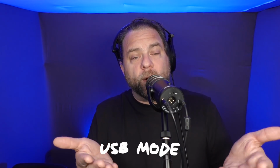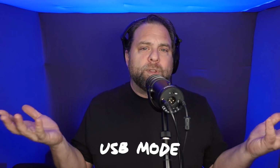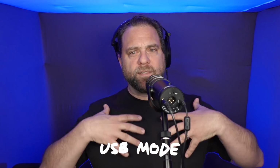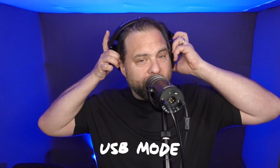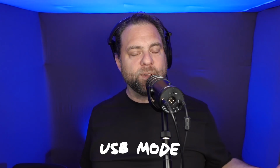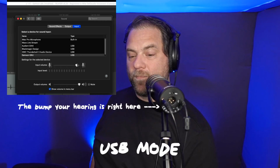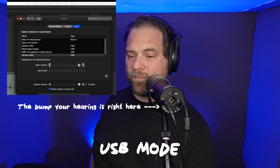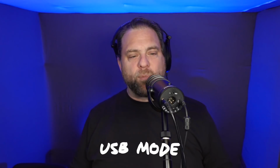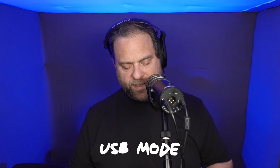Okay, so this is the USB mode, and hopefully that helps. Should sound like a microphone. The quality, I sort of chuckle there because the quality of the USB is far less important for me. I think from a USB perspective, I want it to be loud and clear. In my experience, it's got a little bit more hiss underneath it because I think the preamplifier that's built into the Samson is just not spectacular. So there's more underlying hiss. We should hear it as we turn it up. You can hear that underlying hiss. It's fairly prevalent, and that's just the nature of the inexpensive preamps that are built inside the microphone. At this price point, that makes sense.